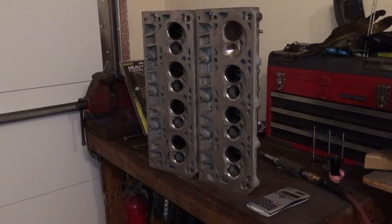I'm not going to blast them. I'm not going to even mention the name of the shop. I started doing some measuring on my bowls, trying to get my math set up on what I wanted to do to best work with this 4.8 engine. Was going to CC one of the chambers to kind of see how much I may or may not mill off the deck surface to kind of boost my compression a little bit. Immediately found out that the valves aren't seating on the seat. Boy, okay. A little bit frustrating. I'm going to go ahead and admit, I'm going to throw that out there.